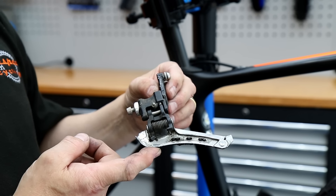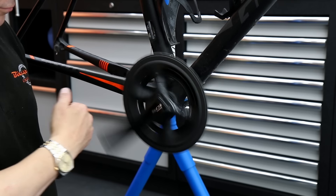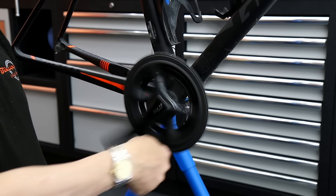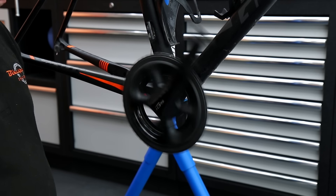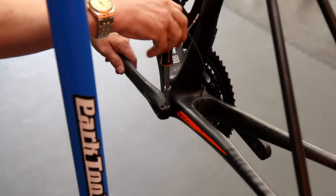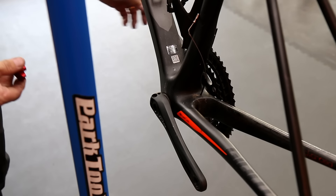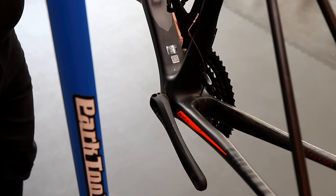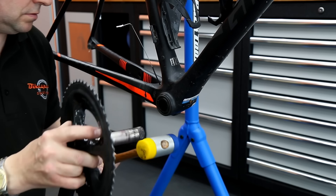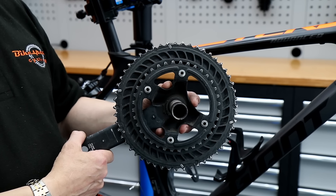Off comes the front derailleur — again you can see there's a little bit of oil residue on the back plate and it's very dry with no lubrication. We need to clean it up. And now you can hear quite clearly the bottom bracket bearings have had it. As I'm stripping the bike down I'm listening for sounds and feeling parts. We also had a problem with the left hand pedal arm which I'll show you along the way. We'll tap out the chain set — it was a little bit stiff, with a thickening oil on the shaft holding it into the bearings.